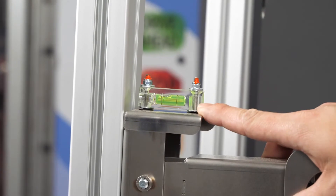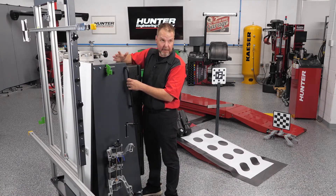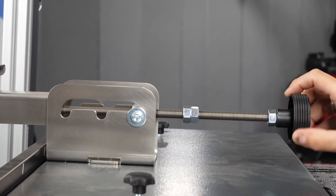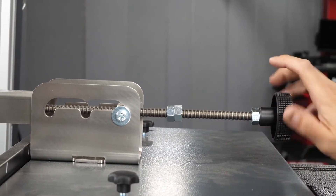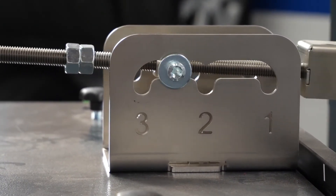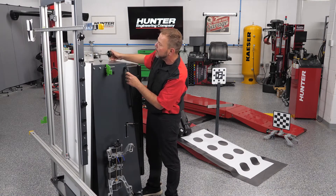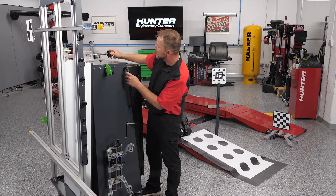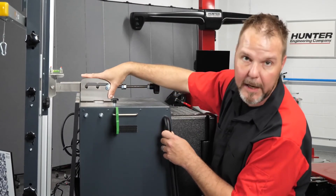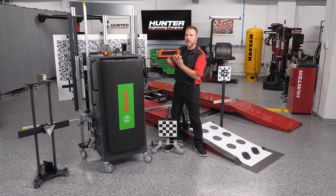There are a couple more components that are really useful when doing front reflective radar-type calibrations. Depending on the vehicle, you'll position and change the angle of the actual reflective board, and it's all done right here — labeled one, two, and three respectively. Last but not least, everything needs to be level before starting calibrations. We have the ability to confirm level by turning this knob, and maintaining level when using those front reflective radar-style boards is one of the most important steps.